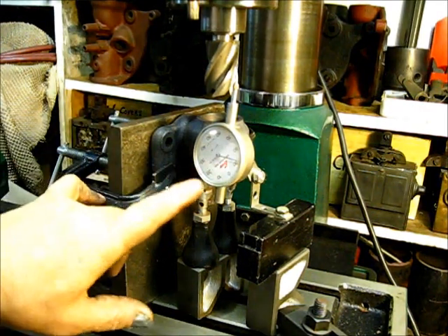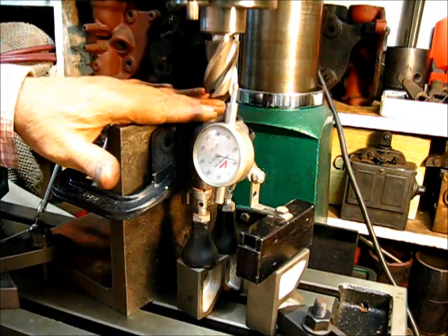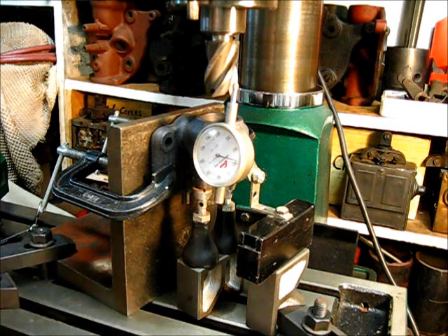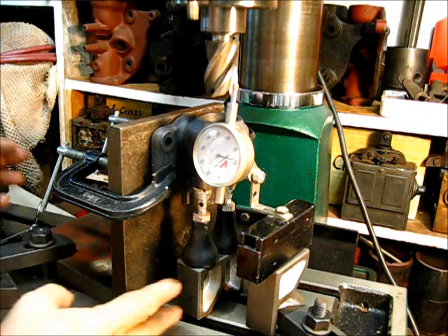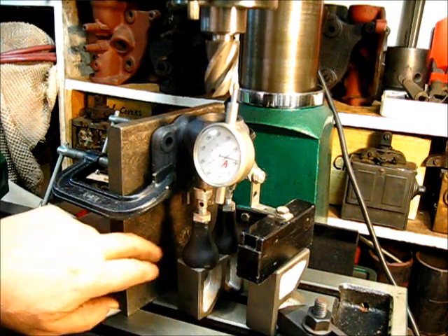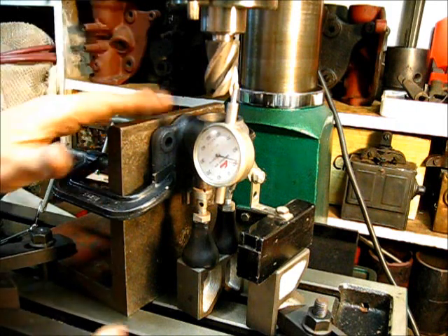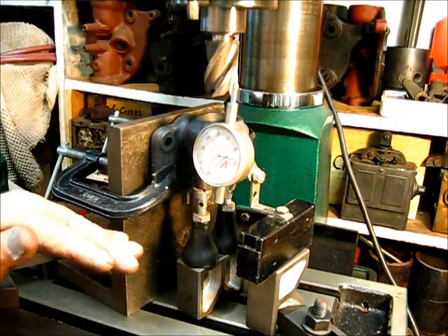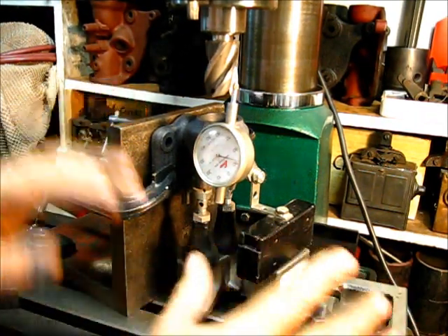This other indicator here on a magnet base and a V-block — and I do have this level and this angle plate right here. That angle plate has served me well. It's quite thick — it was a large angle iron and I sawed it off, then machined it to a perfectly close angle. Works really good. It's heavy — it's a universal type apparatus. I did put two jacks in here because the pressure is going to be downward on this. The angle this way is correct, the angle that way is correct. This is steadfast.